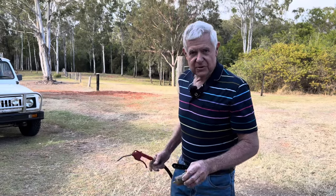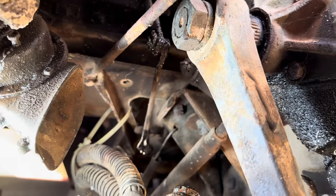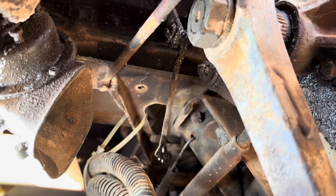It still could be rubbish in the carburettor too. Once you start driving it around, it's only got to have a few bits of old hard varnish-looking pieces in the carburettor and something drifting back and forth over top of the main jet, so the carburettor may have to come off yet. There seems to be a big jump in the gears too. I've got it in low range — when you go from first, very low geared, second, still low geared, third — there's a big step up when you go up into third, and if you're going up an incline you haven't got many revs and it doesn't really want to pull in third, but if you go back to second it seems happy.